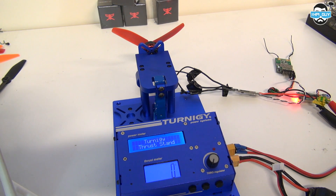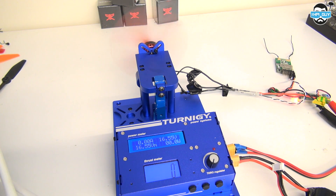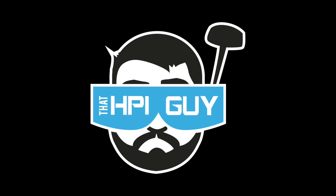Going back to the 2800 KV motors — we're pulling around 32 to 33 amps, which is really getting to the limits of what a 1300mAh Nanotech can handle across four motors on a quad. If you want to keep these motors at peak performance, you're going to need something like an 1800mAh 4-cell with a discharge C rating of around 70. The only thing left now is to strap these 2206 2200 KV motors onto one of my frames, go out for a fly, and let you know what they're really like in the real world. Thanks for watching — I'll be back soon.